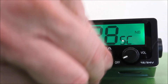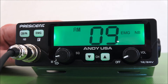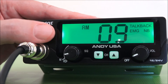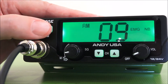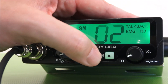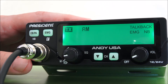One other feature is the push-to-talk button with a TalkBack level. To activate TalkBack, I hold in the mic key and hold the function key — now TalkBack is on. To turn TalkBack off, I hold those in again. To adjust the TalkBack level, I hold the mic key and function key — I can see I'm on TalkBack level 4. I can go down to 3, 2, or 1, or back up to 4. I kind of like it at 3, so that's where I leave it.